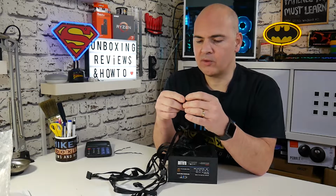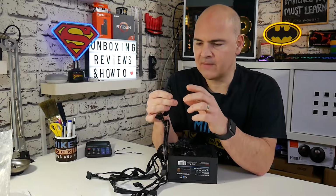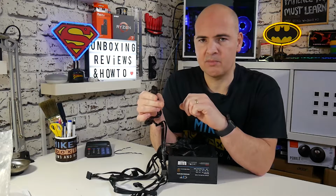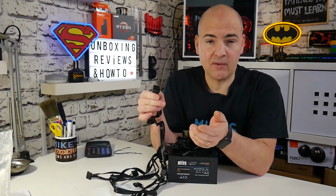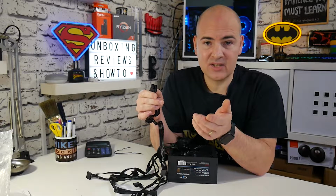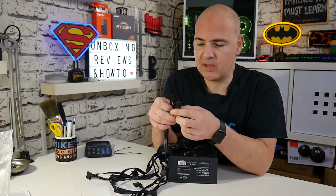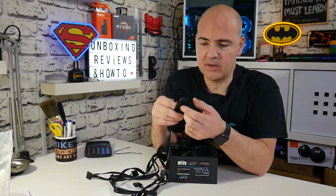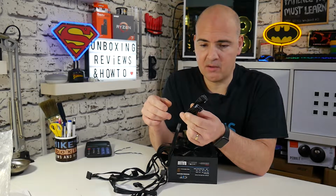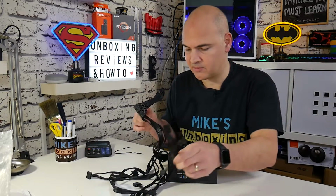Again, I probably wouldn't recommend using a graphics card of a particular high value or wattage. Again, this is a budget power supply, let's not forget that. This is designed for those really budget builds, but say if you're putting together an older system with maybe a GTX 660 Ti, that kind of thing, or maybe a slightly older Radeon card, you should be absolutely fine. Most modern cards you'll find will only use a single 8-pin or 6-pin for the lower end. So again, this should be absolutely fine. But again, we'll put this together in a system and see how it goes, and we'll test a few power supplies and see if we get any problems.